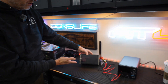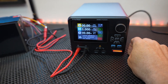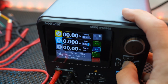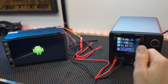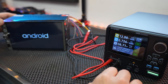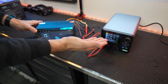Next, we're going to test a replacement head unit for my daughter's car. I often do this any time I install a new head unit because I want to test its functionality and understand its operation before a full install. Here's where the tilting screen works well — we can tilt it up for a better view. I'm on preset M1, already set to 12 volts and 3 amps. I'll keep 12 volts and bump up to 5 amps. We've got our green run light, constant voltage, 12 volts. It jumped to about one amp on the high side but leveled off to about 0.7 amps as it boots up. If we had speakers connected, we could figure out how much extra current it draws at a reasonable volume level.